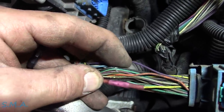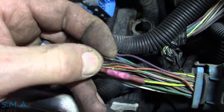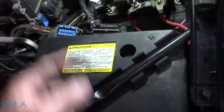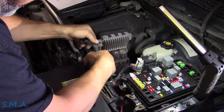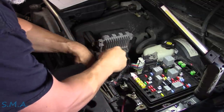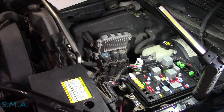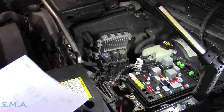I don't see a problem with it - it's good, strong, tight connection. We don't have to worry about solder cracking underneath, which I've had problems with the solder-and-heat-shrink ones in the past - I got burned by them many years ago. I do see some other wires here that I'm going to go through and fix where I believe it's through the insulation and into the metal. Prior to doing that, I'm going to plug it back in, clear the code, start it up, and see if it's fixed. If not we'll keep trucking.